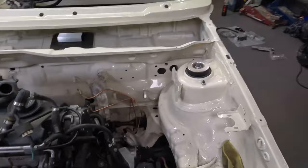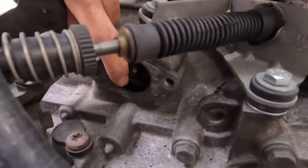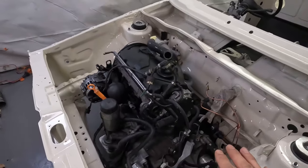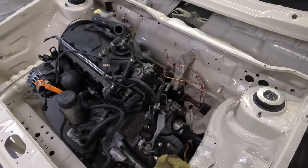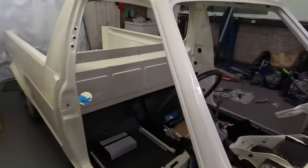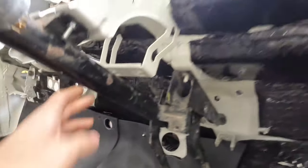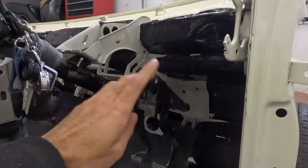...I need to be able to release the clutch, but it works with a slave cylinder in this hole here that will enable you to press the clutch pedal and push or pull the clutch away depending on what you're doing. We're going to be mounting the master cylinder up here and then putting the reservoir somewhere in the engine bay, routing the pipes through.